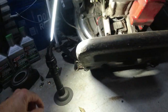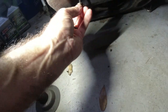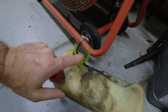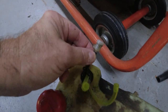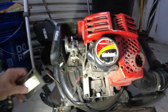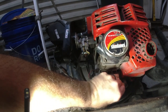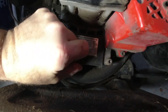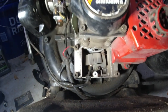There are two Allen bolts underneath here to get the gas tank off. Take all the fuel lines — these two fuel lines — off the carburetor, and then you have the vent line right here. Take that off, get the gas tank out of the way. There's an Allen key right here; take that bolt out and the cover comes off. And here you have your coil.